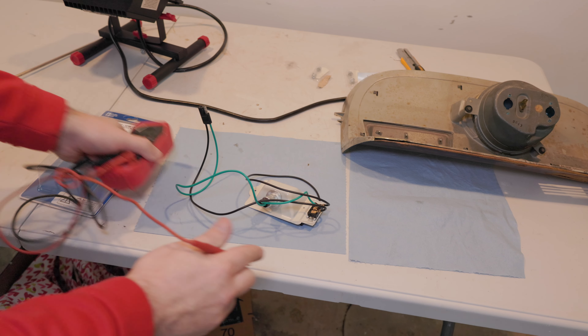We're going to do a sanity check — I'm going to bypass this connector. Yep, this is the connector that's the problem. It's frustrating. It looks like the switch is working the way that it should. I'm shorting across this black lead because the black lead isn't working. It's on this third wire for the glove box light. I've got to go find a connector because this one isn't going to work — I'm not going to cut this apart. To the hardware store.